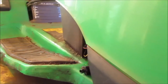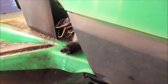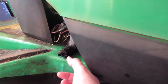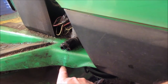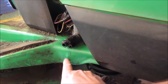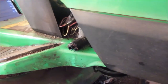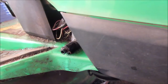I started cleaning up all this oil and while I was cleaning I was looking to see where it's come from. I noticed on the quick drain plug here — one of these half-turn or quarter-turn ones — there's a line down here with dirt around it but a clean line down the center, which makes me think that might be where it's leaking. I'll lift the front cover up and have a better look, but that's a bit of a worry.